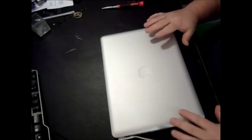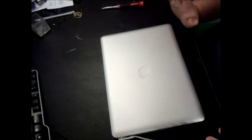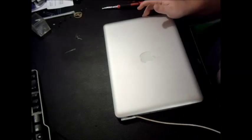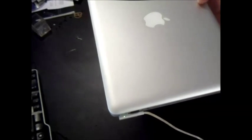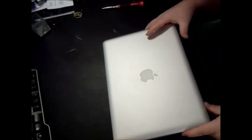What I'm testing out here is this particular MacBook Pro that has a battery saying 'replace now.' Literally if you unplug it, it's going to completely shut off — it has absolutely no cycle power on it. It's just running directly on AC. As you know with MacBooks, when you plug it in, if the light is green it means it's just plugged in; if the light turns orange, it means it's charging the battery, meaning the battery is either good or has a few cycles left — not completely dead.